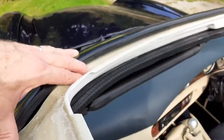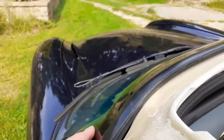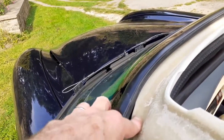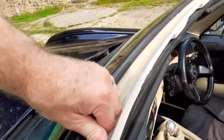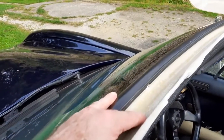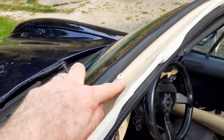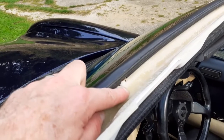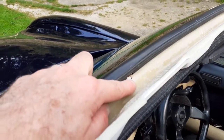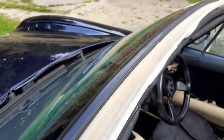Check around the sides - same again. Looking at the rubber, we've got some movement so we can get the outer skin in there, and it'll sit quite firmly when the two halves are together. You can see the locator peg there which might need opening out actually - it's just touching, so it might need a bit more fiberglass taking off there. We'll see when we get the outer section on. But for now that's not a bad fit.